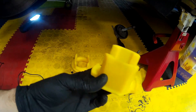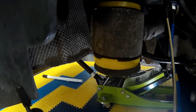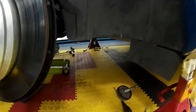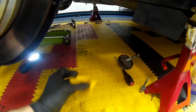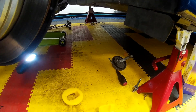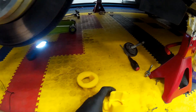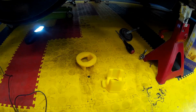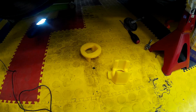This is the lower bush for the front of the subframe — compare it with the one for the rear and you can see the difference straight away. The one for the rear is a lot more substantial and allows the subframe to sit on it because the rear of the subframe moves in a downward direction. The forward one doesn't need all that extra material as the subframe moves upwards and will compress against this bush. If you have bought two sets for the rear there is no reason why you can't use them at the front, as it is only the lower part that is slightly different. But if you bought two sets for the front, you definitely do need to order the correct part for the rear.